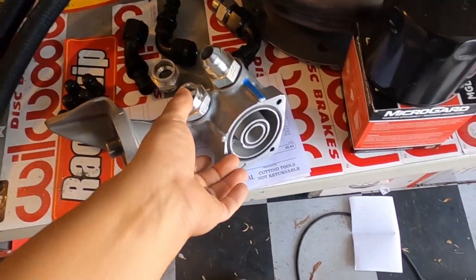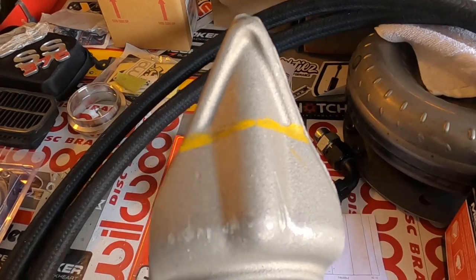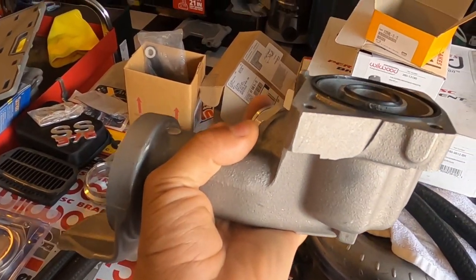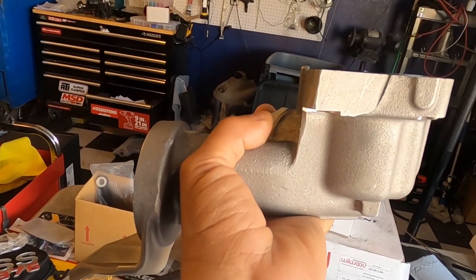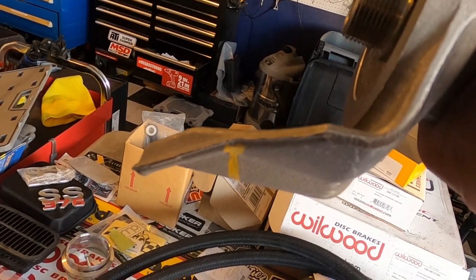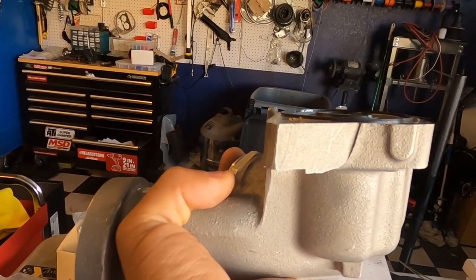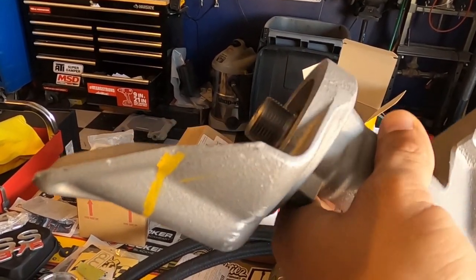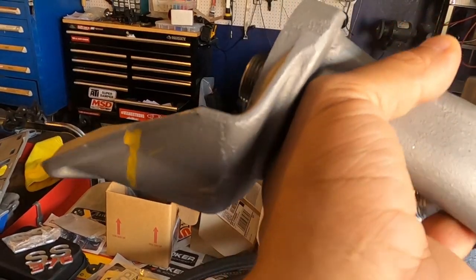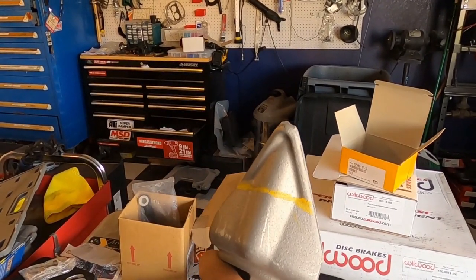So that's what we're working with today — a couple 90s and a couple 45s, we'll see what we can make work. I've already mocked this thing in there and ran into an issue with the sway bar. See that line right there? When this thing goes up and you try to get it screwed onto the block, it's bottoming out right where that little lip is — hitting the sway bar — so it doesn't let it sit flush against the block. So I already marked it and I'm going to have to notch that. It won't hurt anything — it's more like a shield than anything. We'll notch it there and then we'll throw it up and see what it looks like. But we also have to get those AN fittings on there first.